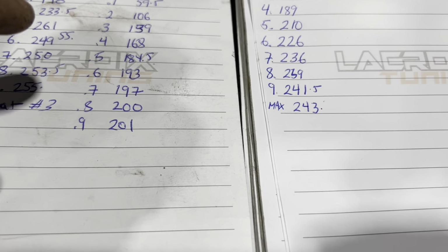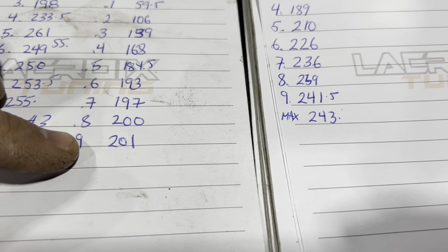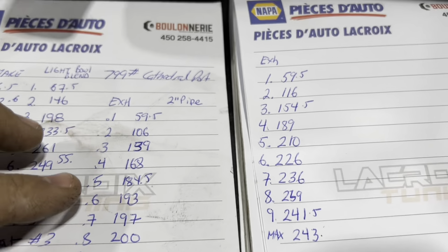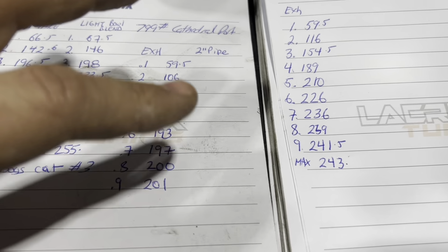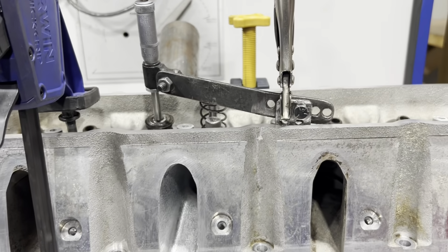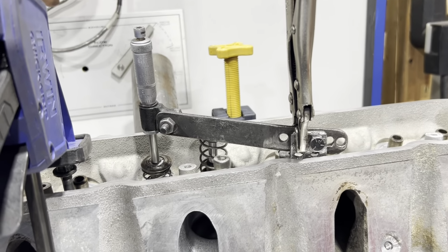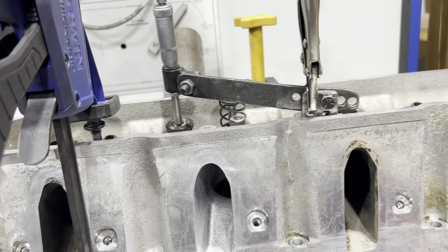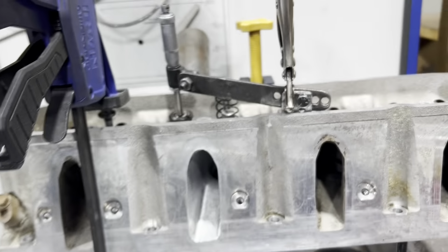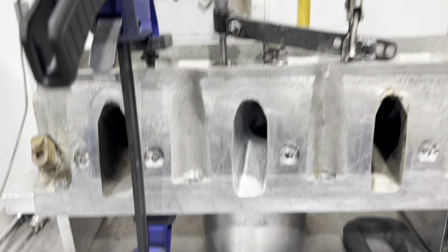And all the way down the valve, we gained 40 plus CFM. I mixed myself up over here, don't mind me, you guys can see the difference. It's quite outstanding, the difference for the work that I did. And I still maintain it this way like before, because maybe if I had flipped it around the first time I tested, now it would have fewer restrictions. So I kept it the exact same way, same port, same valve, same everything.